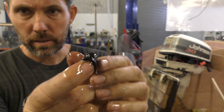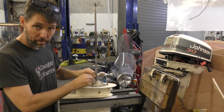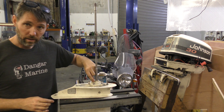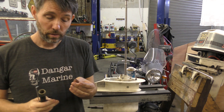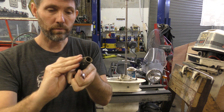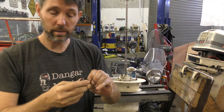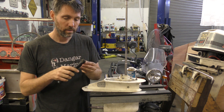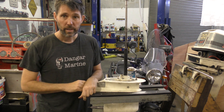Here we've got a little water pipe grommet — it's got these little bosses on the edge, so we push this down into the pipe outlet on the pump until those bosses locate in the holes, and the lip sits on top. The last two things in the water pump kit are two more o-rings that go around the two ends of the driveshaft spacer. This actually only had one o-ring at one end, so it's good to replace those. Put a little run of grease around both o-rings, then pop it down the pump and that's pretty much it.